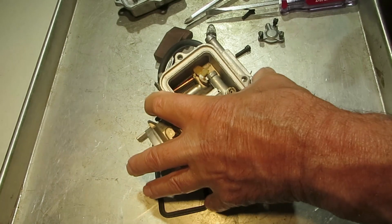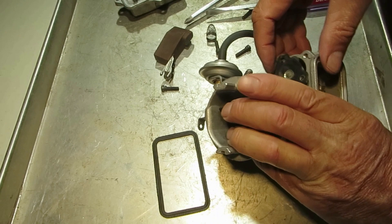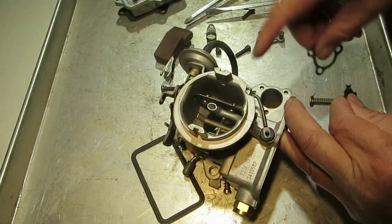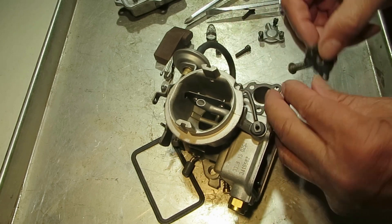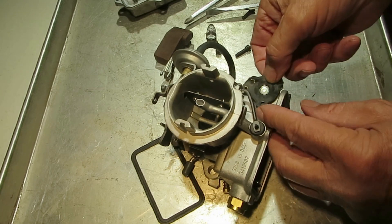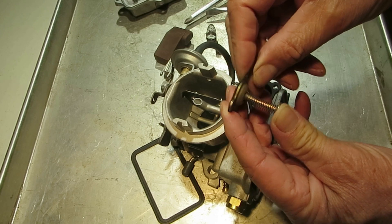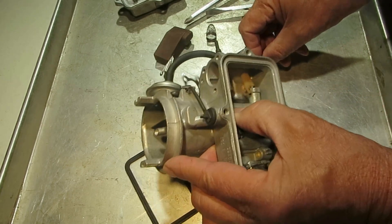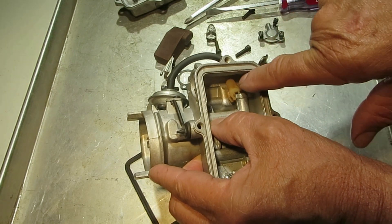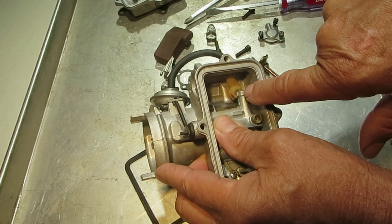Your vacuum starts here, doubles up through the carburetor, up to this hole right here. And you have your economizer diaphragm here — fits right there. What it does is when you get the most vacuum at idle, it pulls up this spring right here. And with that spring pulled up, this raises the check ball, which is spring loaded, pushes it up and closes off this inlet right here.